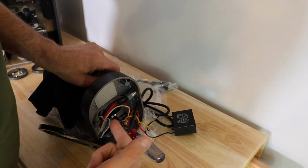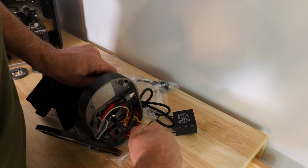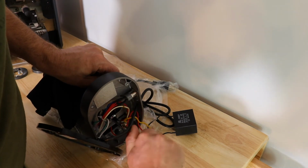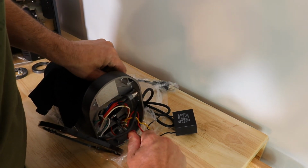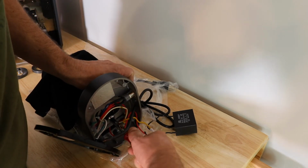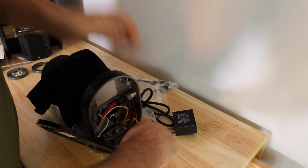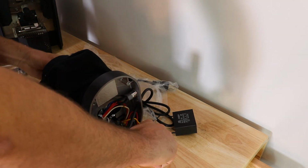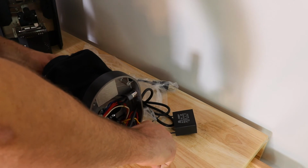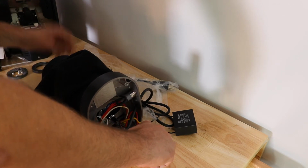So we're going to watch that disc again, make sure the disc is not spinning. Loosen this up. Move the lever over, and then tighten it. Tighten it pretty good, and then do a test. Now that I tightened it, I hear the burrs touching.